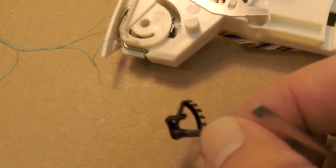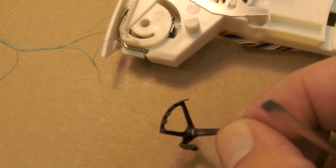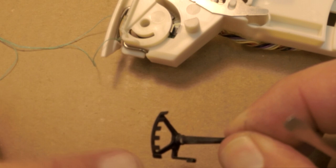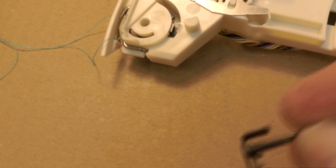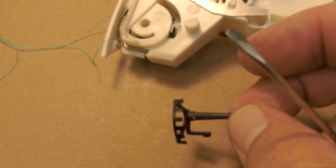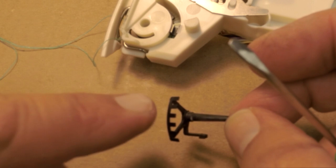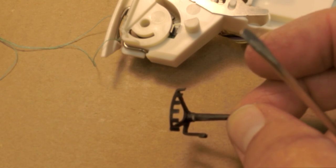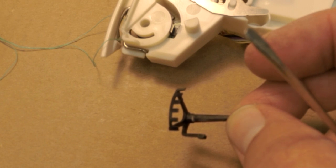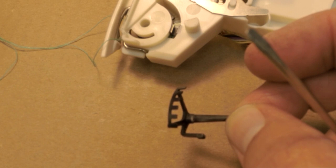It makes the contact to the machine and tells it, yes, you have thread, you have thread. Here, it actually counts 5 each time you make a stitch. Now, if for some reason the check spring is not going all the way up, that means it starts to count maybe only 2 or 3. So the machine starts to know that the top tension is not fully there anymore.